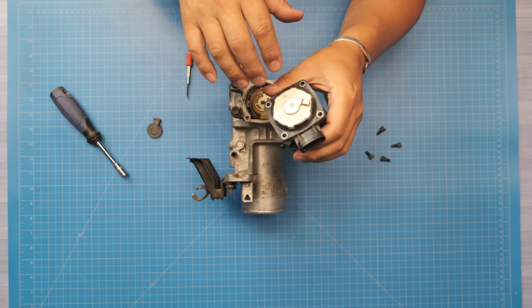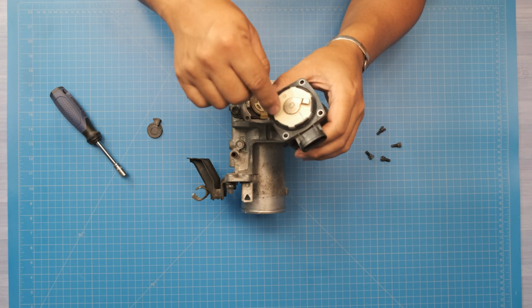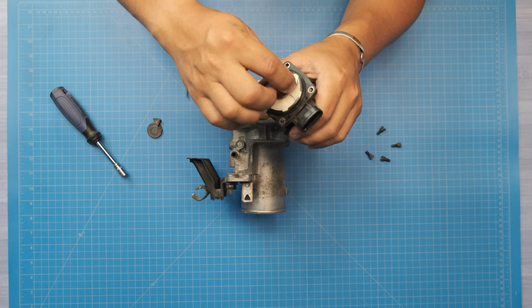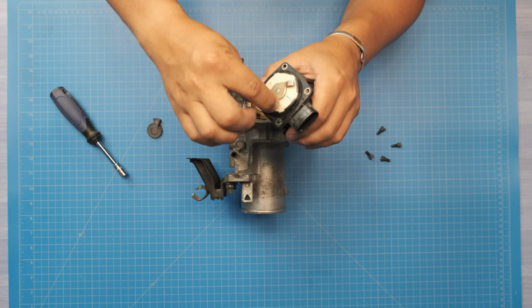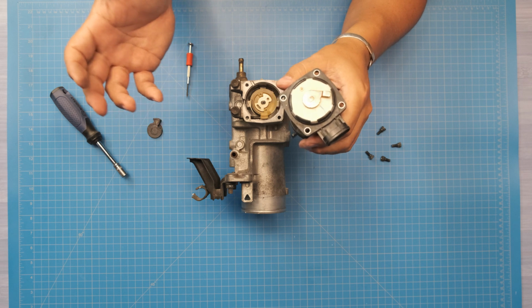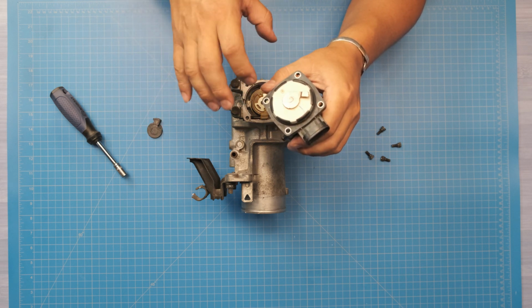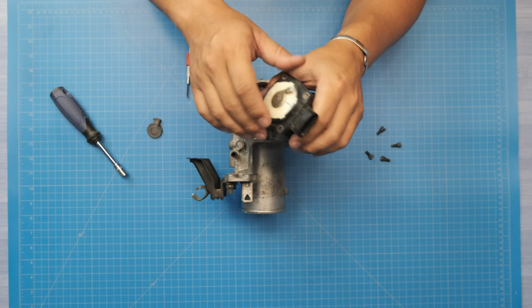So if you're getting one of the accelerator pedal position codes, failure codes, it's usually this, and it's usually those solder points. So what you do is you take a little knife or Dremel, cut it along through here, and then resolder them, put it back together, good to go. A friend of mine has a video specifically outlining that. I'll throw a link in the description so you can get to that.